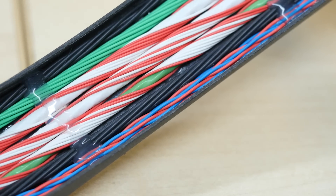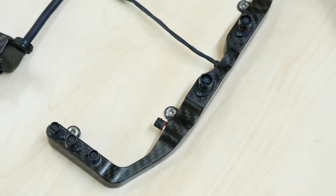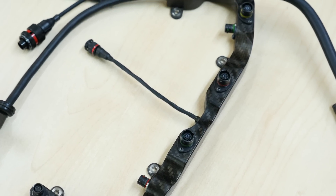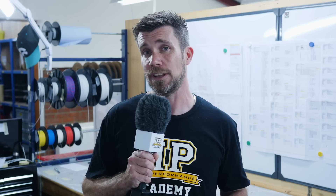However, this isn't a technique we'll see in Formula 1 harness construction. Instead, a parallel twist of the wires is used. The advantage here is that no filler wire is required, meaning that the harness weight is minimised as well as the bundle size. One of the advantages of concentric twisting is the added flexibility, but this really isn't an issue in an F1 car because the harness is designed integral with the chassis. In some places it is supported within moulded carbon fibre components, ensuring the harness is supported correctly and doesn't need any additional flexibility.